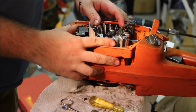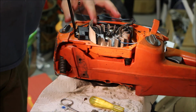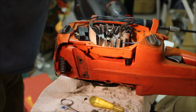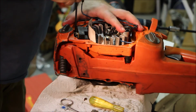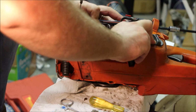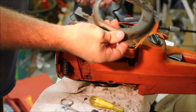Bring the magnet over. So it wants to touch, but it can't because there's a business card there. Cinch both your screws down. By hand is best. Back it off, pull the business card out, your gap is set. New shroud.